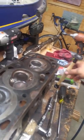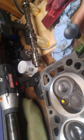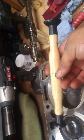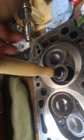Everybody, working on lapping these valves here for the Ford Ranger 98, 2.7 or 2.5 liter engine. I had a bad number three valve - we addressed that already. So to show you guys, you're gonna want to pick up some valve grinding compound - got this at O'Reilly's, they have it at AutoZone, Pep Boys, whatever. You're gonna use one of these guys with a little suction cup, get a little suction on there, and put a little bit of that paste right around the valve seat.